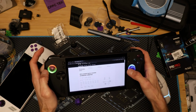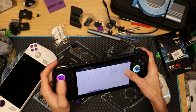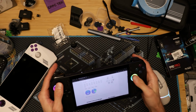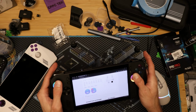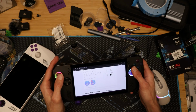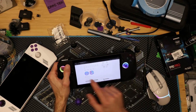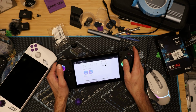Let's just make sure our joysticks and everything still work. I like to go to the gamepad tester on hardwaretester.com/gamepad, and then we'll check. Yep, everything still works just fine. Now the error rate on these, by the way, I haven't recalibrated them. For sure there's gonna be a little bit of an error rate since we've moved it around, but that one's 3.5. I need to recalibrate this right one right here, but about 6% is probably on par with what most of the other ones are without being calibrated. 3.5, that one's pretty good. I don't think I need to mess with that one. But this right side, I'll have to double check and recalibrate.